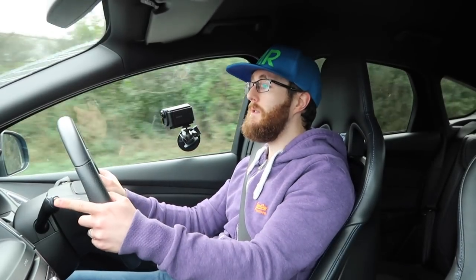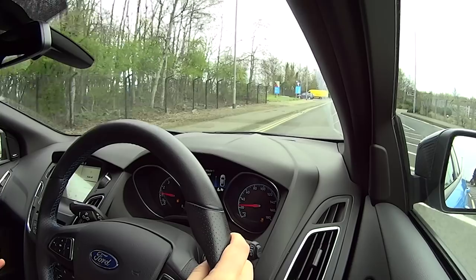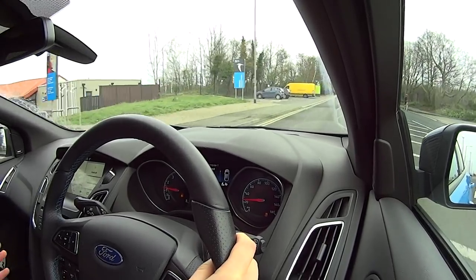When you switch to track mode and get the sport suspension setting turned on, those stiffer dampers mean you're not creating as much lean back, not getting as much angle, so not as much unloading of the front wheels — therefore less likely to get that extra slip. If you're in sport mode, you can also hit the little button on the end of the left-hand stalk to turn on sport suspension as a potential alternative. The other thing track mode gives you is ESC off, which in sport mode you can also do by pressing various buttons — but track mode does it all for you immediately.